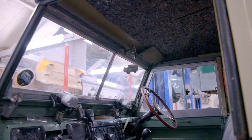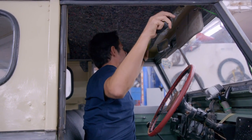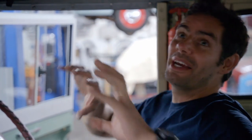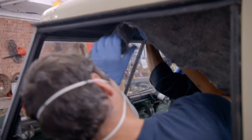This cab can be a noisy place, despite the sound-absorbing felt added by a previous owner. New material specially designed for car interiors, laid over the top of the old felt, will improve both the look and the sound quality in here. If you're wondering why I'm measuring this out first - if you don't cut the material to size beforehand, you end up wrestling with it like an octopus in a very small space. So I'm measuring it, cutting it properly to size, then gluing it in. I spray contact adhesive directly onto the old felt, then it's a two-man job to lay the new material over the top.